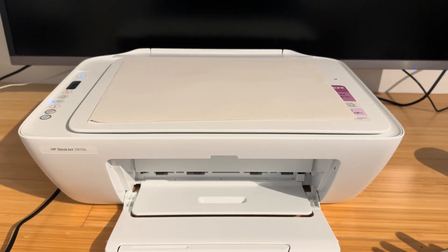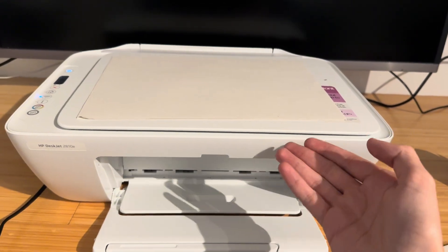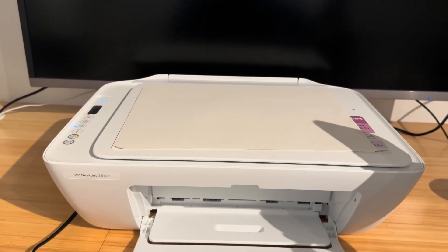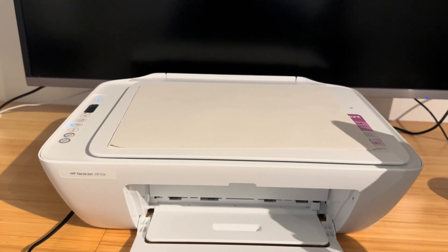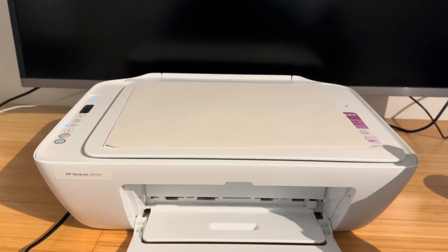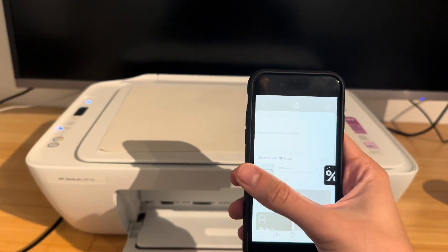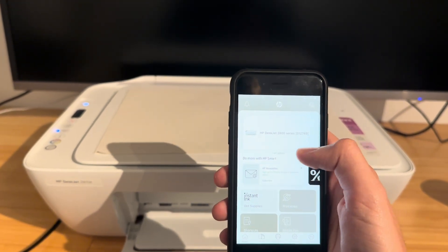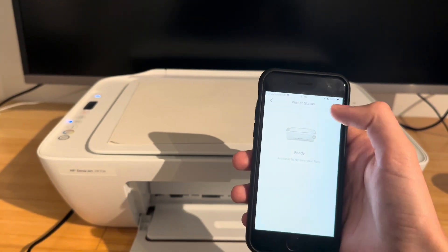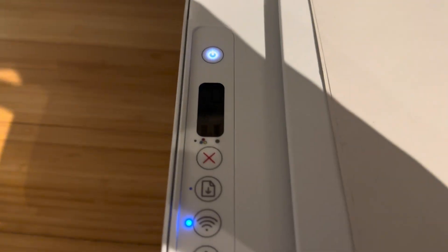It's been a few minutes and the printer is now back on, but let's say you're still facing the issue — it's still printing blank pages. Well, probably what we should check first is whether the printer actually has ink. So quite simply we're going to open the HP Smart app and have a look. If your printer is connected to Wi-Fi it will show up here and tell you whether it has ink in it or not. You can check your printer status, but you can also check directly on the device itself.